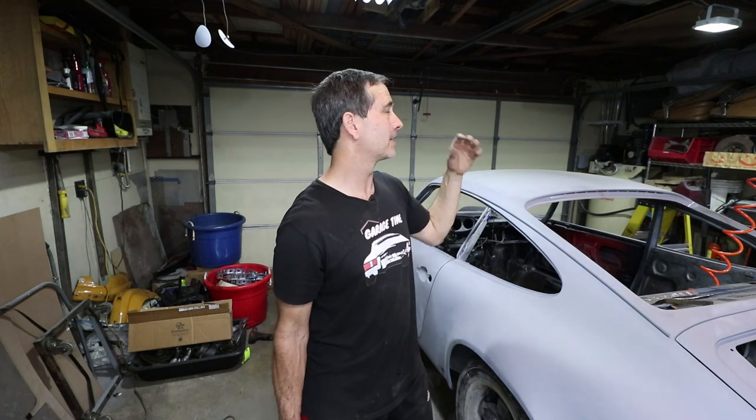They're really nice. The only drawback I see, like I learned with the other ones, is, and I'm mostly done with the welding, but when you're welding and there's too much light in the back of your helmet, or these spotlights kind of shine behind you, it can put a lot of glare on your welding helmet. So when I have been doing lots of welding, I actually prefer sort of a dim garage. So one solution would be to put a back on the helmet, like a shield on the back, so that light doesn't get in.